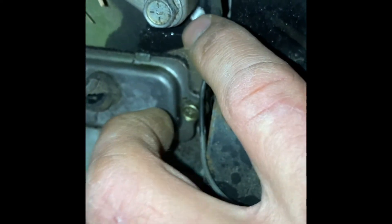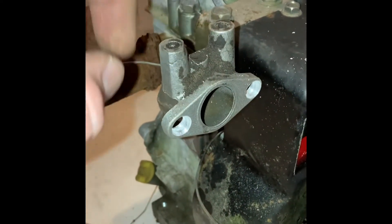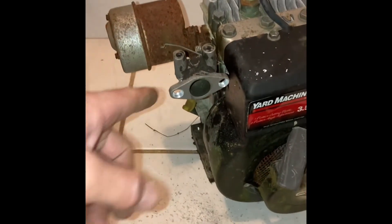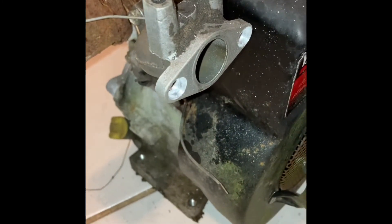Other than one bolt, the original carb goes here — there's another threaded hole already there, and it bolts up for that intake. I can't believe it, it was so cool. I believe this is off of a 5 horsepower, so someone might correct me if I'm wrong, but these intakes off of other Briggs and Stratton engines work perfect. Keep that in mind because this could save a lot of you guys a lot of trouble. If you've got one of these engines and you have another parts engine laying around with this intake, you're doing good.